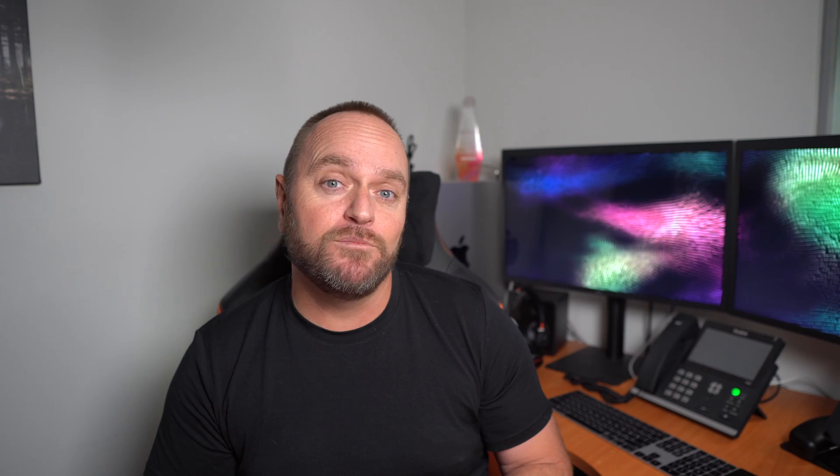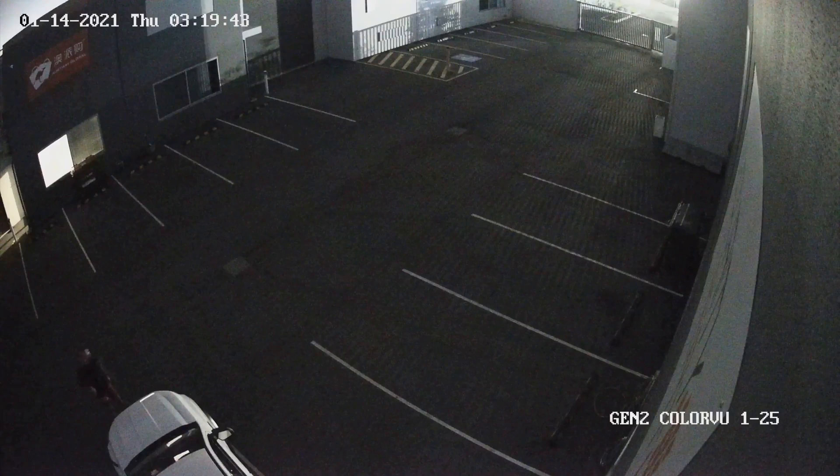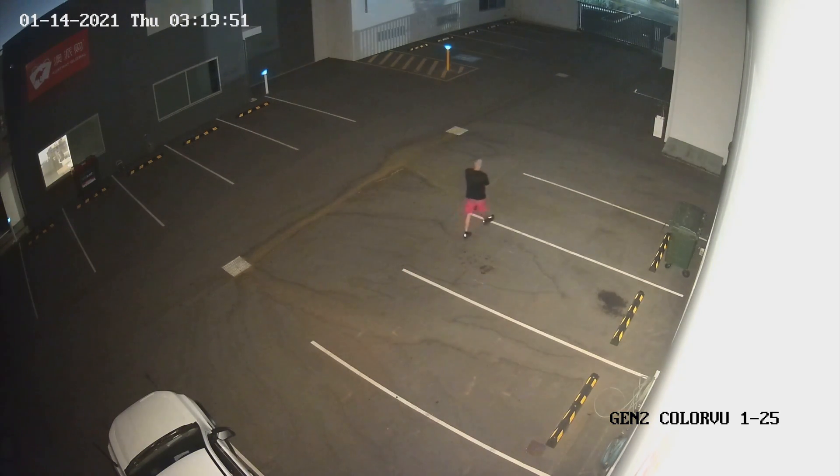That not only helps us get a good picture, but will also act as active deterrence — because obviously if someone walks into your property and suddenly the light comes on, that's a call to action to do an about face and get out of there. Out of the box, this comes with a 1/12th exposure time, so the only issue with that is that we're going to have around a second or so while the camera adjusts to all the light in the image. The solution is to tweak that exposure time up just a notch by changing it to 1/25th of a second. We're still getting a little bit of lens flare, but it happens so much quicker and basically it's not a problem.